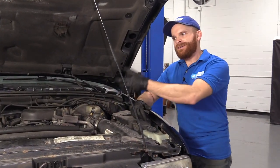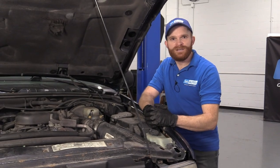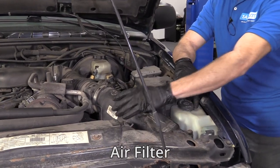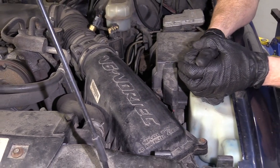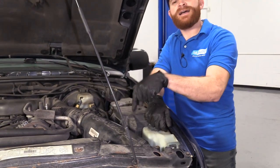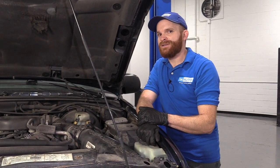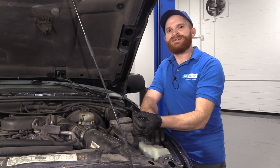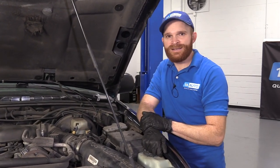All these things I've mentioned so far kind of fall under the lines of doing a tune-up on your truck — and yes, it is. So with doing the tune-up, you'd come right to your air filter. If you remove the mounting screws and lift this up, that's where your air filter is going to be. You want to take a look at it and make sure it's clean and free of all debris. Also make sure there isn't a mouse or anything living inside the air filter box — it's very possible you'll find some acorns in there. Get all that debris out, double check the air filter for any nibble holes or bite marks, and if it's dirty or has an issue, replace it ASAP.